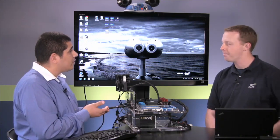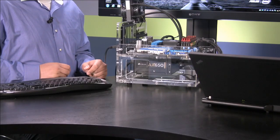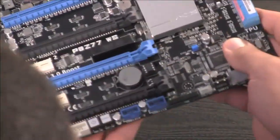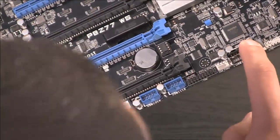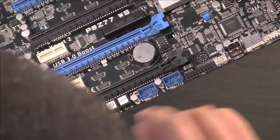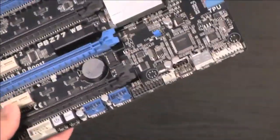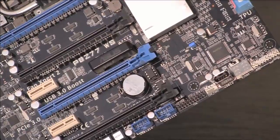So let's take a look at some of the ways we're approaching overclocking. Right off the bat, on the board level we've got some physical switches. On the WS board we've got two different switches. The EPU switch is the opposite for people interested in overclocking — it won't make any changes to frequency; it only executes an undervolt algorithm. So this is great for people who want to run stock but apply less voltage to the CPU for lower operating temperatures.